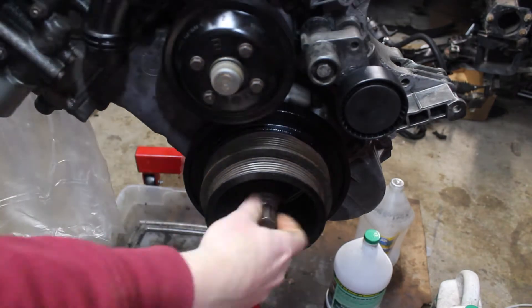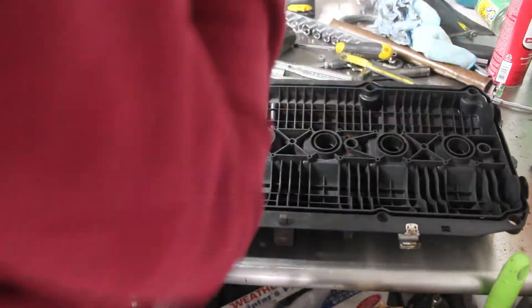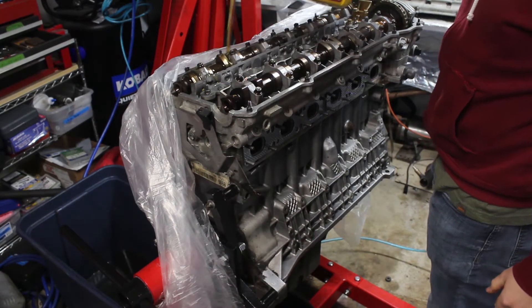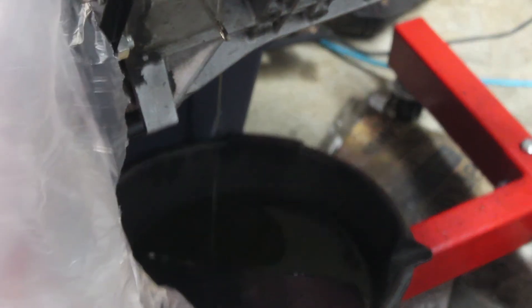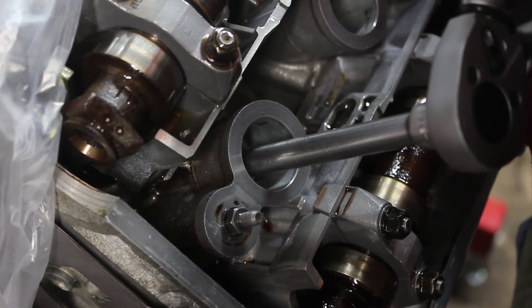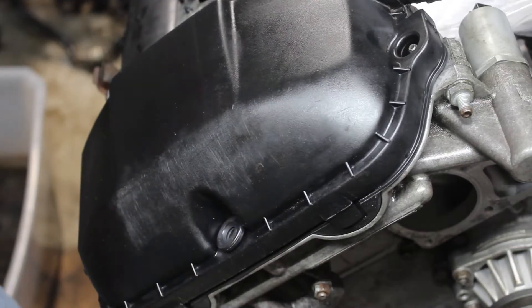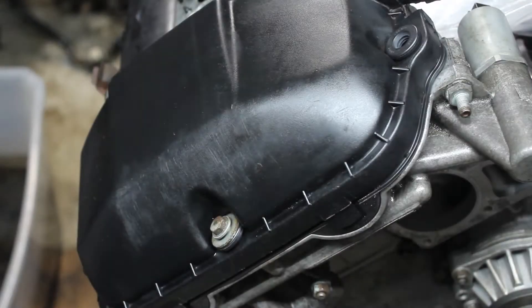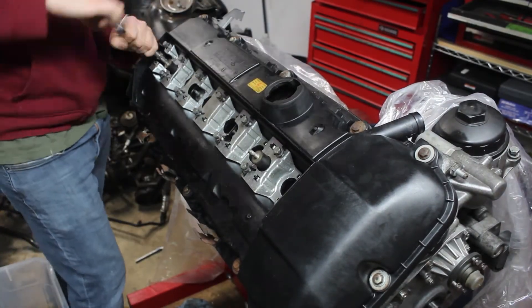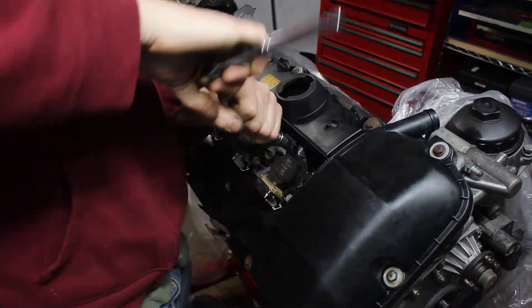I can finally install the valve cover, which needs a new gasket put in place. First I decided to flush the engine with some oil, just in case there's any debris that could be cleared out. The spark plugs went in too, and I paid attention to their torque spec. It feels like they're yielding, but it's just a crush washer compressing. The valve cover goes on at last, making sure the gasket doesn't fall out. New grommet pieces get installed and I tighten them all down. I install all the coils and make sure to attach their grounding straps. The valve cover is finished and it's almost time to take the engine off the stand.